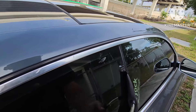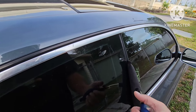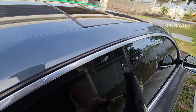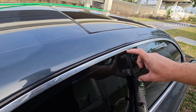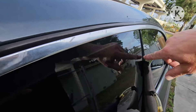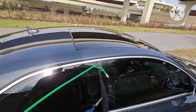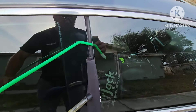When you do, it's going to kind of pry that glass out. Now, with it being a frameless window, a lot of guys will freak out and think you can't use this airbag — that you've got to get this special tool from Access Tools, like a little wedge thing, a glass guard. I don't like those. The glass will flex. All you need is enough room to get your tool in, like that right there. And then just take your reach tool and kind of finagle it through the glass like so.